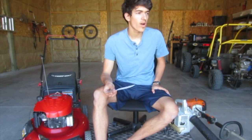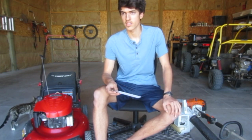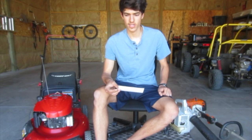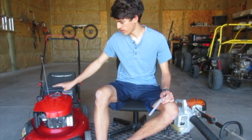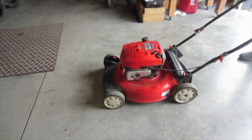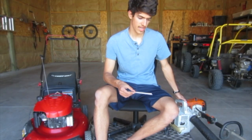At this point you're probably saying, why aren't two-strokes used more widely if they have all those advantages? That's where we get into some disadvantages. One primary difference is that two-strokes are made to rev way higher — the RPM range is much different. Most lawnmower engines are set at around 3,000 RPM, while these small two-strokes can get up to 7,000 or 8,000 RPM.